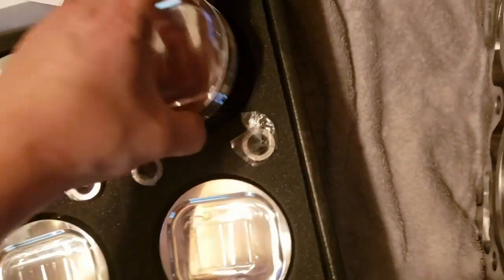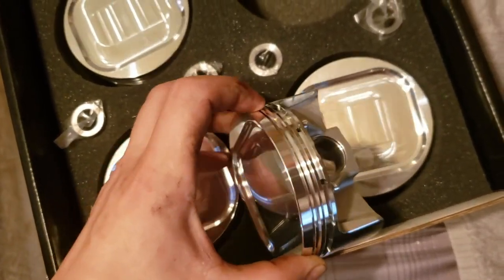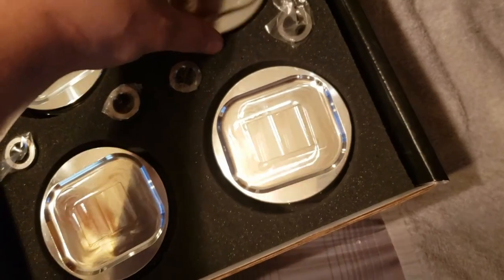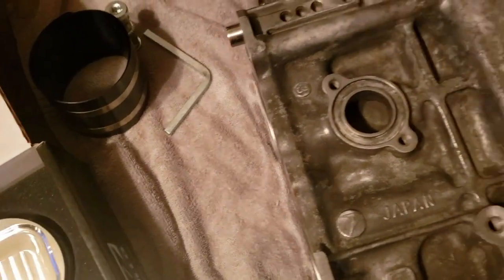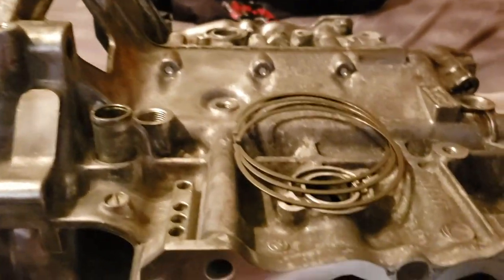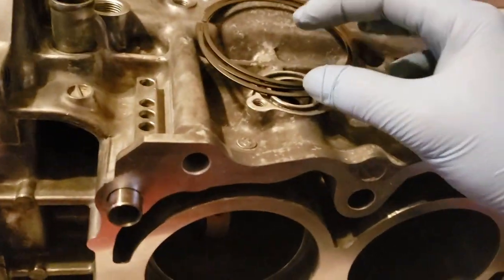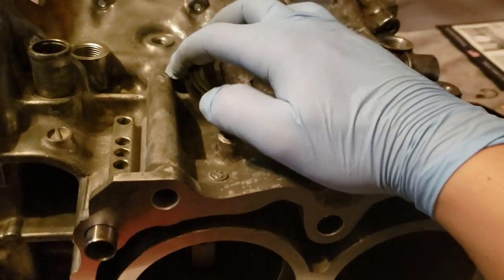I like how it's packaged — you got your first ring, second ring, and your oil control rings. When we go to put in our rings, we'll put in the second ring first, then come in from the bottom to put in the oil control ring, and put the first ring on last. I'll double check the tolerances. Now that I've checked all my piston ring end gaps, they were all pretty spot on from CP — I just opened the gap up about one thousandth of an inch if that.